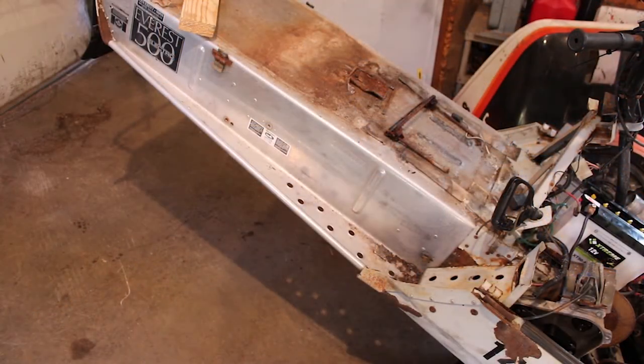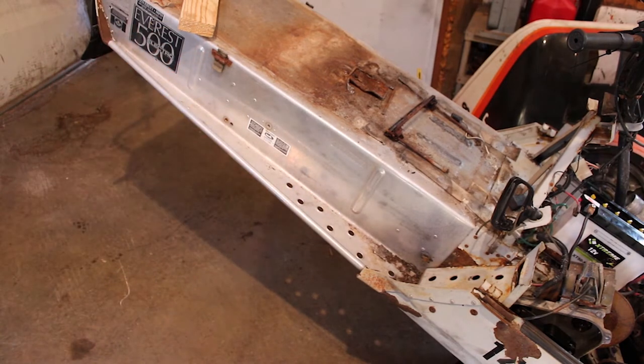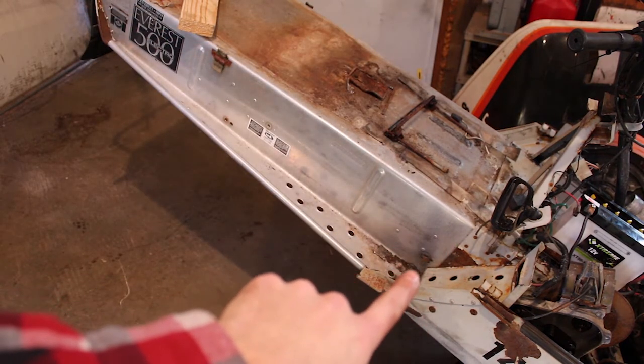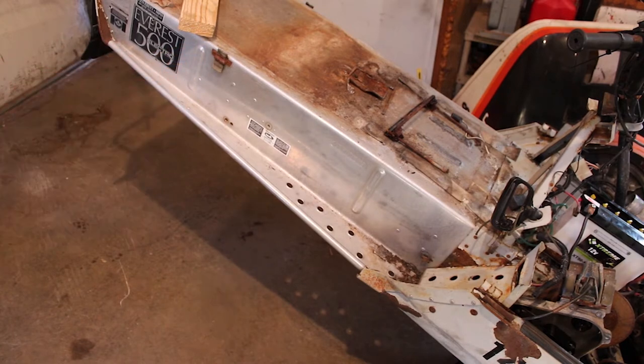So before I go putting the drive shaft and the track back in there, I need to get my holes drilled and the mounting plates moved and everything on the tunnel to get the skid mounted properly. So what we're gonna do is leave the front arm plates where they're at and use those existing holes. These rear arm plates are gonna have to get moved back to about this bump out in the tunnel. So I gotta drill those rivets out real quick on both sides and drop those plates and then get the measuring tape out again. Mark some holes, drill the holes, and then re-rivet those plates in place. Should be pretty quick overall, but you know, famous last words. We'll see how it goes.